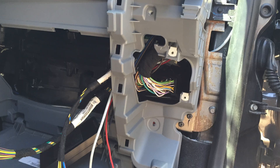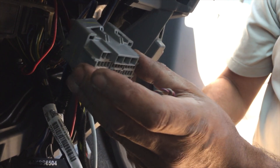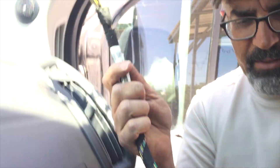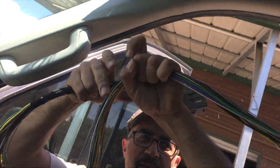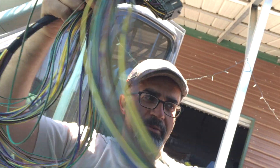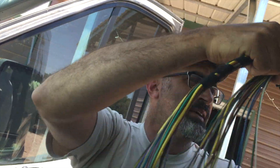Underneath the glove box, which is folded down here — I pulled off all this other stuff just to get it out of the way — you can see there's a 43-pin connector, this massive connector that's got a white clamp on it. The trick is it actually comes with this cap which has a couple of jumper wires in it. You have to open up that cap and remove it. This is the 43-pin connector and it's got all these different circuits — that's for setting up your ambulance.